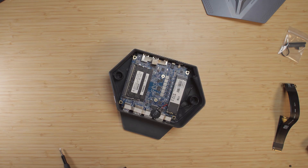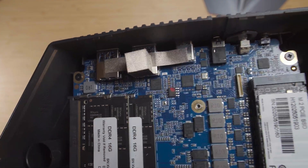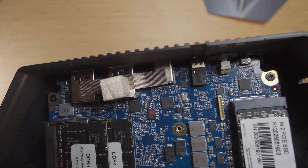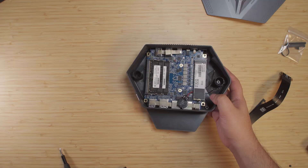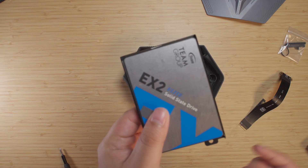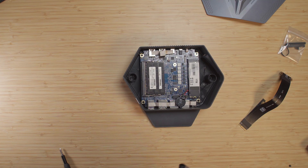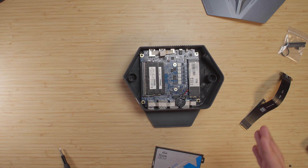I've already done that before and it definitely makes a difference in terms of cooling, and I want to pair it with this adapter here. This is going to be a bit more of a challenge because it only has one M.2 slot, meaning that the NVMe drive is going to have to come out. As for storage, it has a little SATA adapter that you can plug into and use a SATA SSD. So as a boot drive, I'm going to be using this Team Group SATA SSD — I hate this thing, but it's the only SATA SSD I have laying around and it should be fine enough for this project.